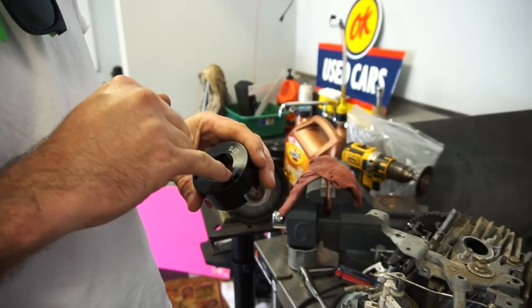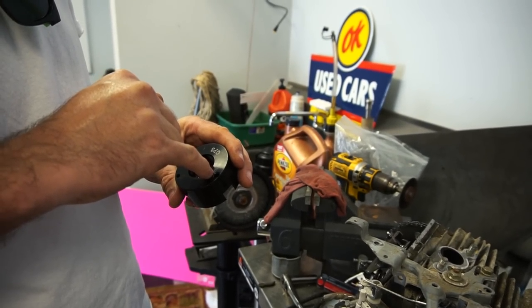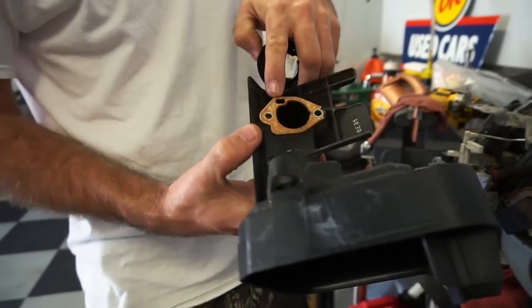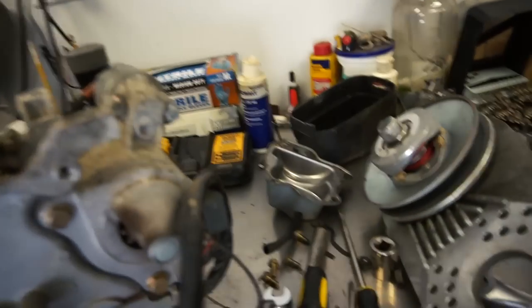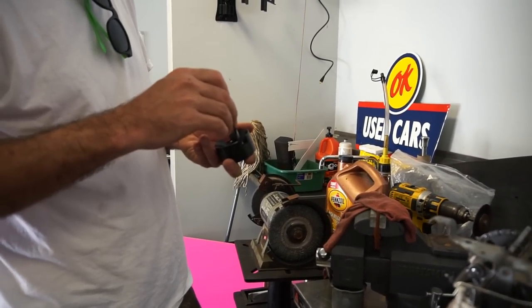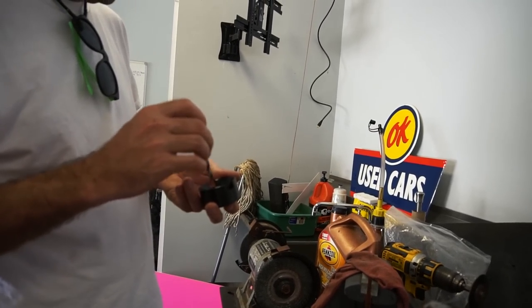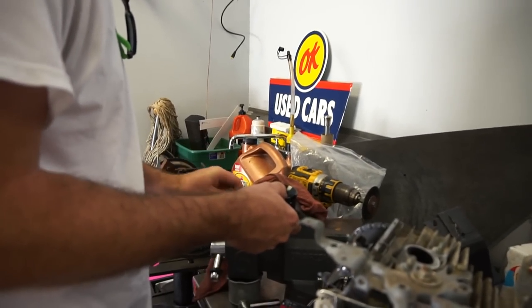The 212 adapter is too skinny. So what I'm going to do is pre-drill a small hole and then go with a bigger one. We also have a different bolt pattern here so we're going to have to grind. We're going for it - we're going to modify - well, ruin - I mean modify. We're going to slot it and make it universal.